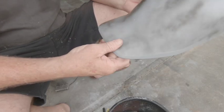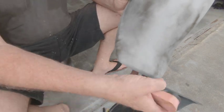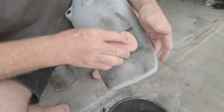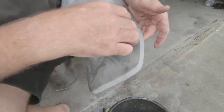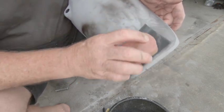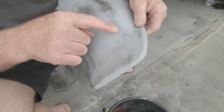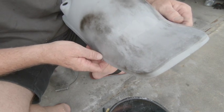It's been a few days, so it's time to rub it down with some nice clean water. We'll see quickly where we did that repair — we should see some marks come through. You can see there's some scratches in the primer here, some marks over here, some scratches here, and that's what we've got to keep rubbing until we get them out.